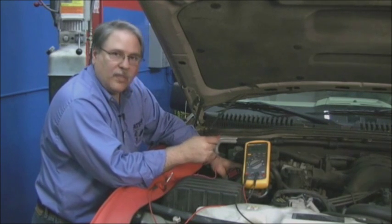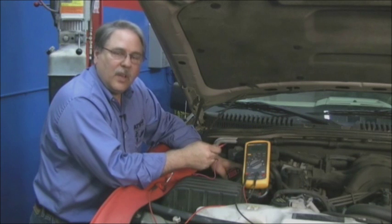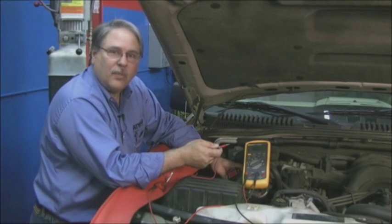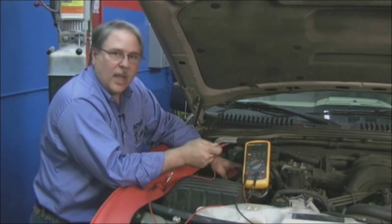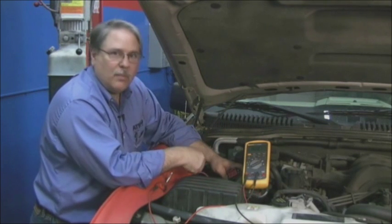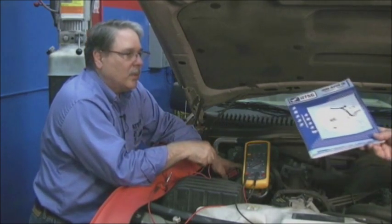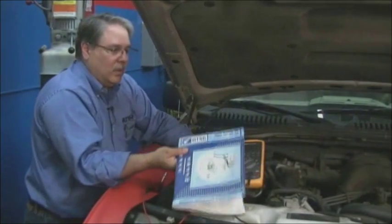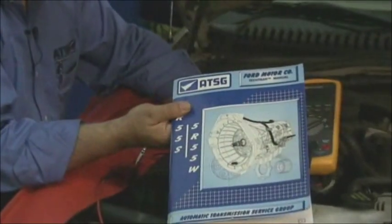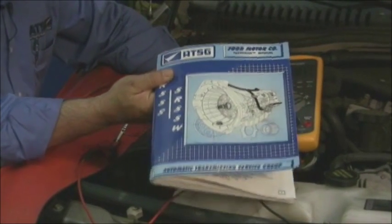Everything I'm doing can actually take a matter of minutes. I can do this fast solenoid check so quickly — I'll know I've got power there, I know my ohms are there, and I know my current draw is there. I can do it in a matter of minutes. This type of solenoid fast check — if you really scrutinize different wiring diagrams — you can figure out how to do this on many vehicles. For example, Dodge vehicles have a relay that supplies power to the solenoid block on the 41TE transmission. ATSG has a book with all the information we've been discussing — connector pinouts, wiring diagrams, solenoid resistance — available on the ATSG website.